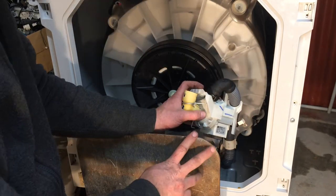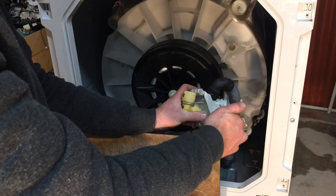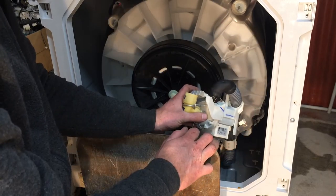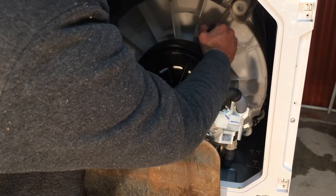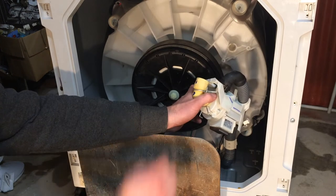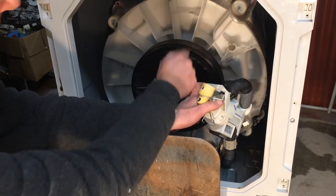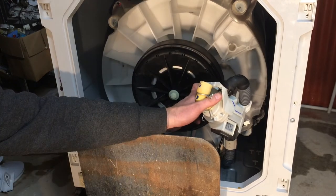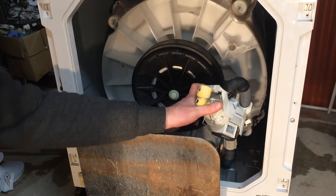You could look up into that hose there if you had a blockage you couldn't find somewhere else — it's unlikely that anything's going to get past the pump and then get stuck there, but that's one place to look. And of course we can get into the inlet to the pump, and if you've got something up in the top of that, have a look at my other video on how to clear a pump from the top — it's basically the same on these machines as the earlier ones.